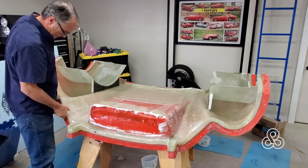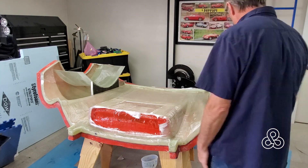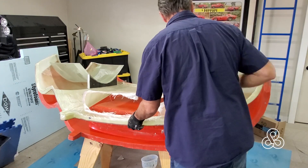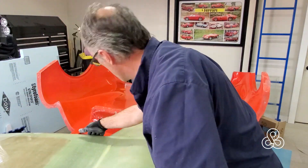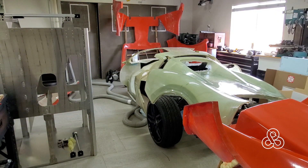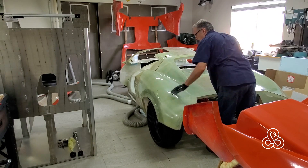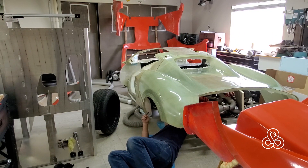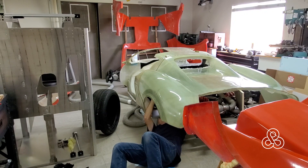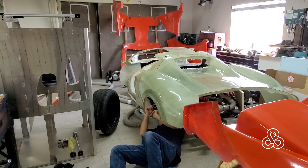It releases pretty well everywhere except right around what will be the rear window access area. I got a sliver — always a danger with loose fibers and resin — so throw some gloves on when working on those ragged edges before the thing is trimmed. Spinning around to the tub to try to fit it all together, there are a few interference problems, which is what this trial fit is all about. My main interference is right under the wheel well where the exhaust system comes into contact with that new flat panel, so I'll climb under and mark with a Sharpie where I need to trim — minimum trim so I don't take too much off.